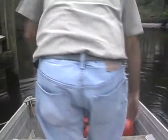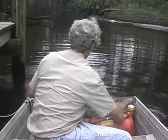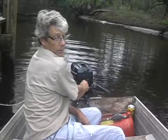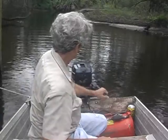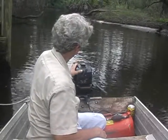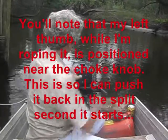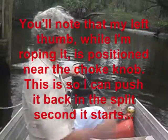We got a cold start. Pump the gas up. Here's your choke. This is the fuel shutoff I'm talking about. Don't try to turn it. It doesn't work. Throttle's up top. Check your throttle, your full throttle throw. Give it about 25-30%. Pull the choke. Not quite.